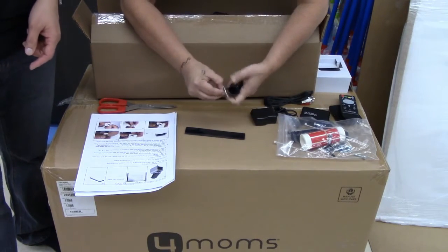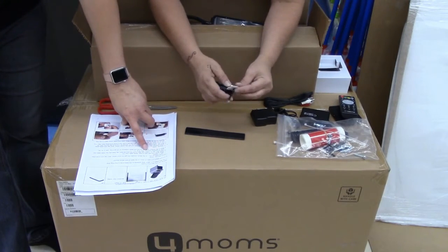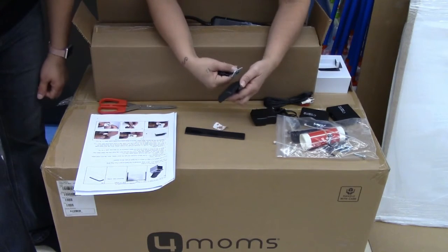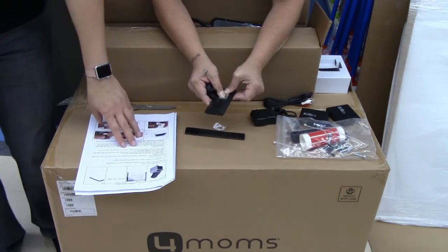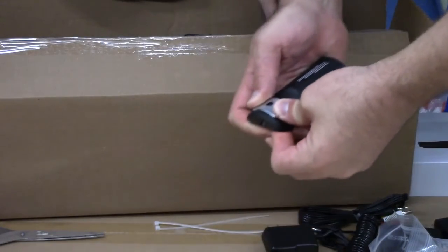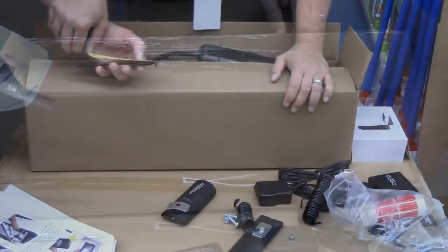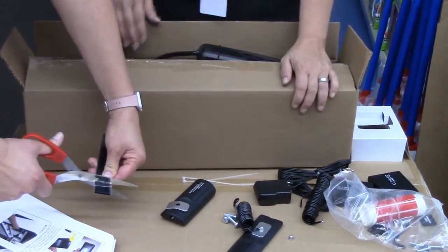Next, you will set up one TV remote and one micro player remote, although you will receive two of each. Use the extra batteries from the second TV remote to power the micro player remote. You will secure the remotes to the interior of the car seat podium, which will be installed later using tethers. The tethers are installed with a dome cap and metal backplate, which adheres to the backside of the micro player remote. For the TV remote, you'll need to bend that metal bracket around the contour on the underside of the TV remote to ensure that it will adhere properly. You will then adhere one inch and a quarter strip piece of Velcro to the underside of the TV remote just under the two protruding tabs.